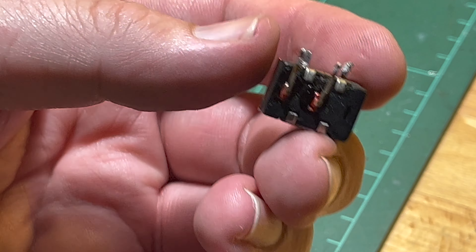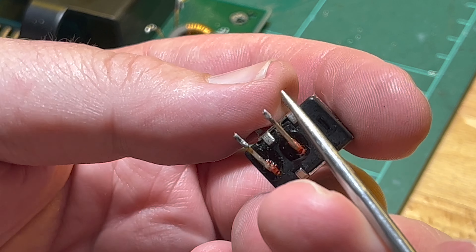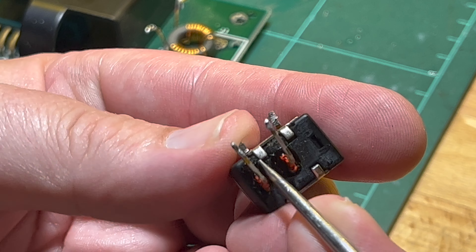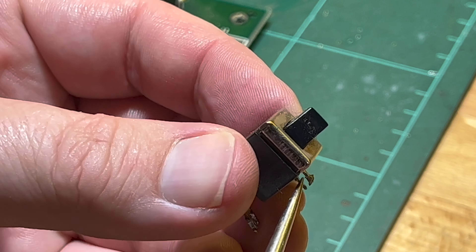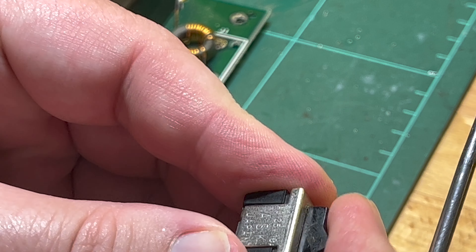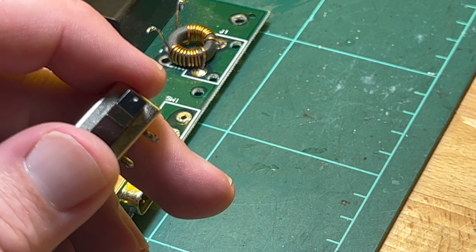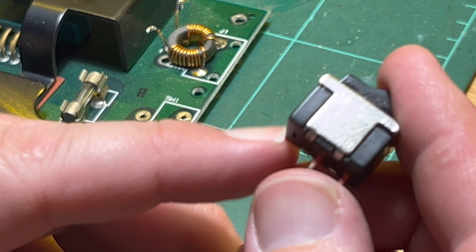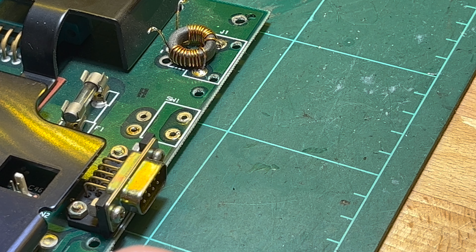If you want to open this up and fix it when it's having problems, use a small flathead screwdriver to open up the tabs on either side, then open the middle and you can get the switch out - there's a metal contactor down there. You can give it a spray with electrical clean and lube, or just re-lubricate it. I'll add this one to my collection and probably put it on eBay one day.